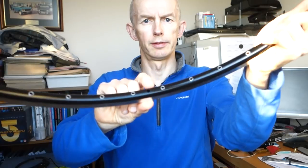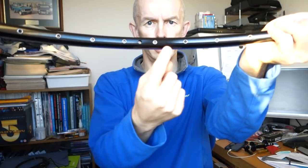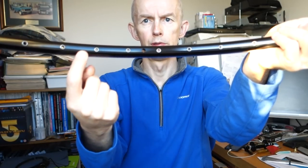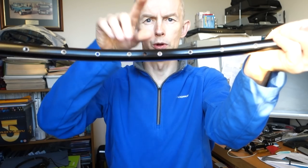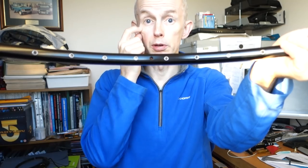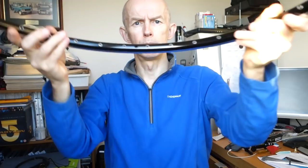And I've got my rim, obviously. Now with the rim, you've got to find the valve hole because you're going to start at the valve hole or near the valve hole next door. And you'll notice that the eyelets, the bits where you put the spokes through, aren't in a line on this rim. They're offset, so one's up, one's down, one's up, one's down, and they're offset towards the side that you put your spoke in. So you've got to orientate the rim the right way up as well,